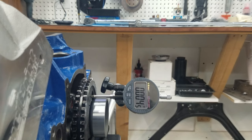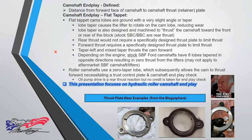Let's talk a little about camshaft end play: how to check it, what some of the problems are, and how to fix them. We're especially going to focus on distributor driveshaft gear wear, which end play has an effect on. A lot of distributor driveshaft gear wear and gear failures are not related to end play, or end play played only a small portion.